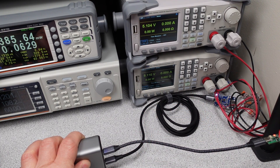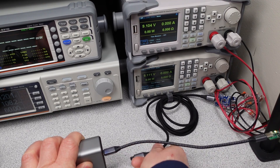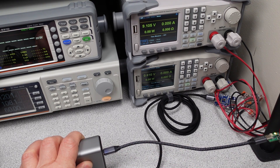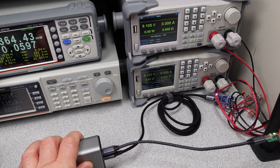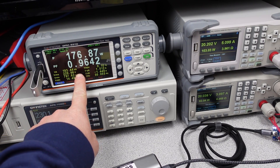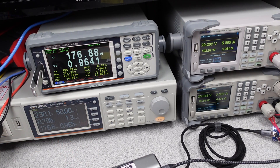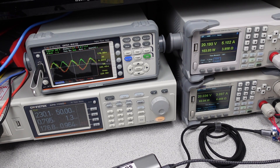Overall, the power sharing is quite good. With four things plugged in at once, it's 60, 45, 30, and 30 watts — not even power sharing, but that is okay. The power adapter did not claim Department of Energy 6, which is a standard for power supply efficiency. It didn't meet the requirements at 120 volts, and at 230 volts it won't meet the EU requirements. It does meet the less strict and older requirements for Australia and the California Energy Commission, so it should be for sale in California, at least.